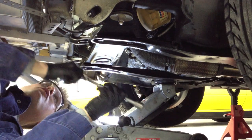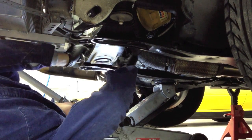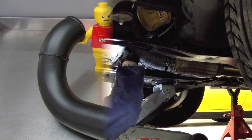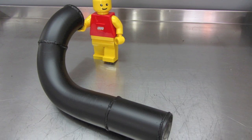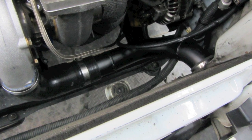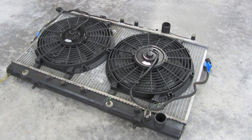I then reinstalled the modified motor mount parts and the new turbo oil drain bits. After even more cutting and welding, I whipped up this new 2.5-inch lower intercooler pipe. It fits much better than the old one ever did. I also switched to dual slim fans to allow as much room as possible for my next job: fabbing up a wastegate dump tube.